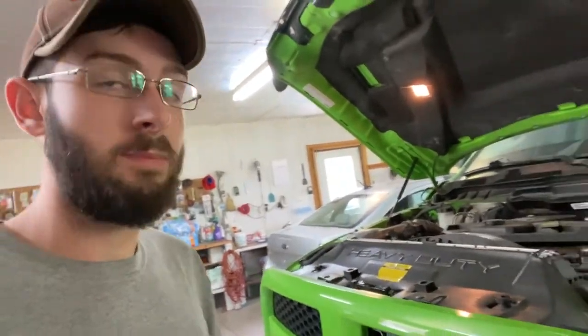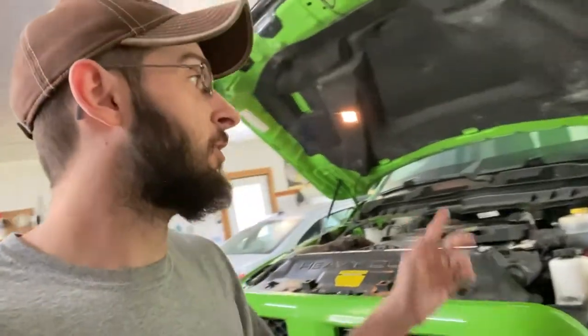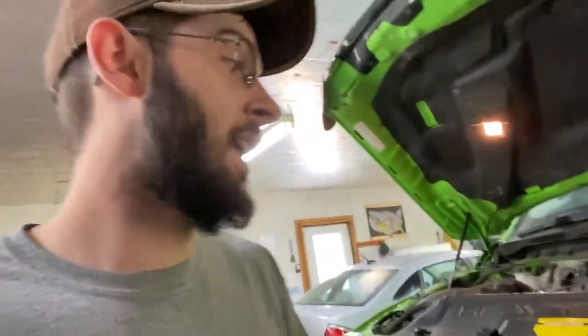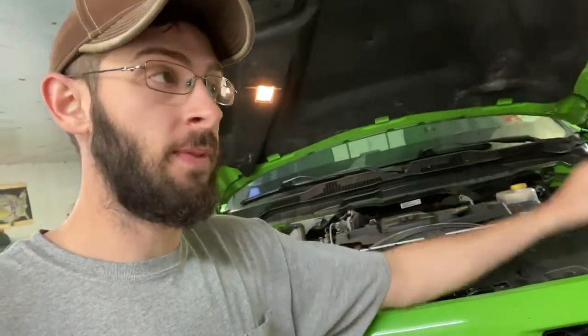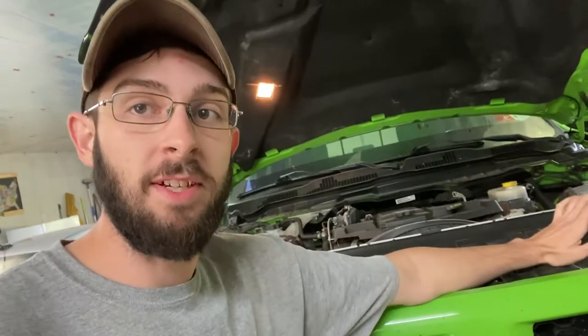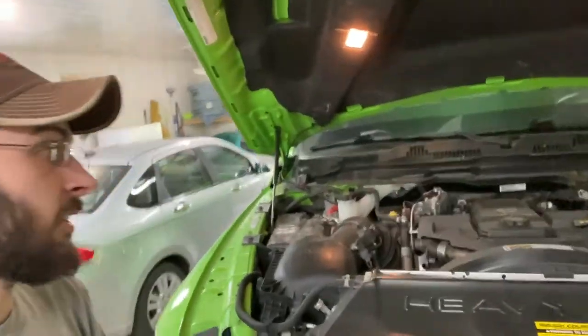I don't put any fuel in my fuel filters when I install them, but this thing starts up awesomely. I know on my old second gen that I used to have, it only had one filter up here, and it took forever to get it to start. With this thing, I normally average 10 key turns to get it to start. I did 5 this time and tried to start it, and it didn't start. So then I did 5 more, and then it fired right up and didn't even die out once. So just cycle your key 10 times, wait for the fuel pump to shut off, turn it back off, turn it back on 10 times, and then she fires right up, guys.